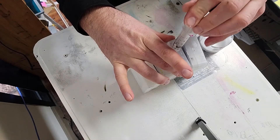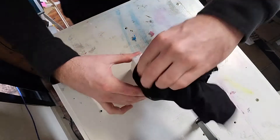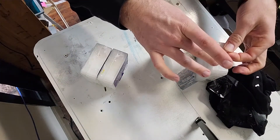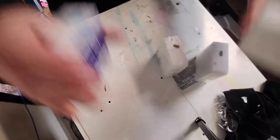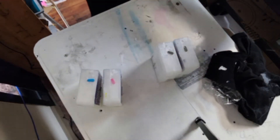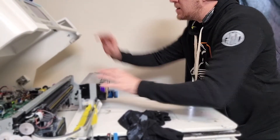So I'm going to fill this up. I don't like it to get too low at all — I like to keep them pretty full. Once they're filled up, take the rag and wipe off the tops of them like so. Then we put our cap back on. As far as I can tell, this bottom hole here is just a vent — no ink is going to come out of it. So we get them in there, plop them in and give them a good little shake. Make sure it's mixed up real well. As you can see, it's completely filled up, and then we're going to reinsert them into the printer.